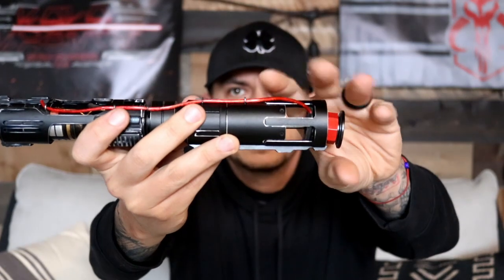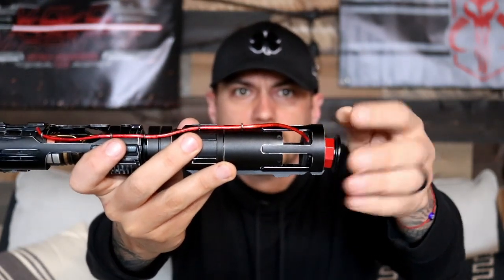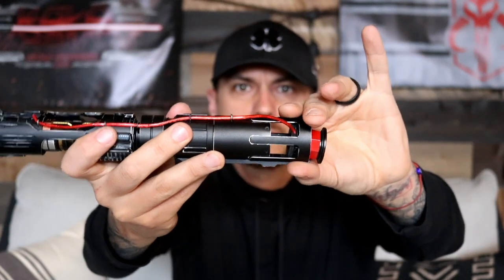So once I got that twisted off, it looks just like that. All that came out as one piece. Now you can take this claw piece and pull it off, and it comes out just like that. And all that's one piece right there. Right, and we set this off to the side. Now you can see your speaker in there. So what you want to do is just come over here with your hand. Make sure you don't stab yourself with this claw, right? But you want to just kind of pop it in your hand a few times, and your chassis will come out just like this.